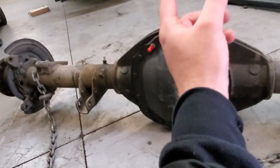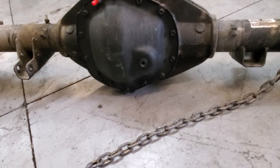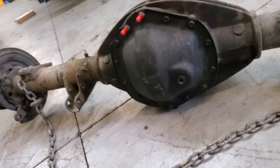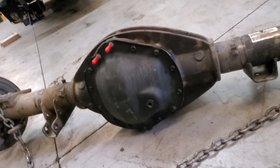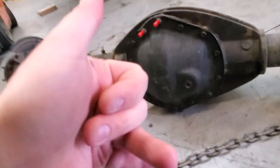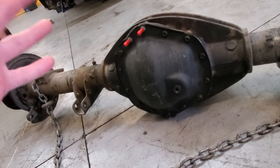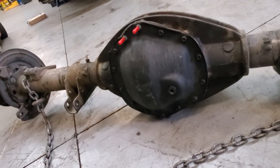To make a long story short — this axle had not a single fluid change for the first 100,000 miles, then they kept it around every 50,000 after that. It wasn't overpowered and it wasn't overloaded. These axles can handle a lot more power than stock if you service them right. I'm at 460,000 and we just did a service — there are some shavings but it's not whining yet, thank God it's not grinding.